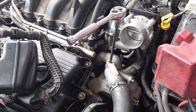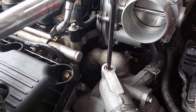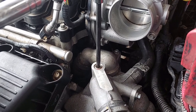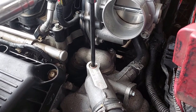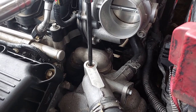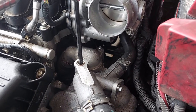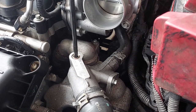Before we put the air intake back on, we need to open up this bleeder and go ahead and top off the cooling system. The bleeder is a 6mm hex and it's held in place with red thread locker. Red thread locker will only give up when you heat it. So if you don't have a good heat source, you're going to have to stop and go find one — you can get a MAP torch, a heat gun will probably work, I don't think a hair dryer is quite hot enough. We wound up using a torch on top of a propane bottle — you can pick that up at Lowe's, Home Depot, whatever your local equivalent is. Throw some heat on this, get it nice and hot, and break it loose. After you do that, you shouldn't have to heat it again.